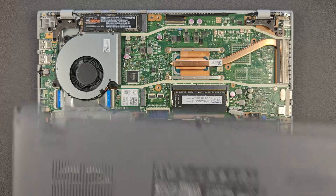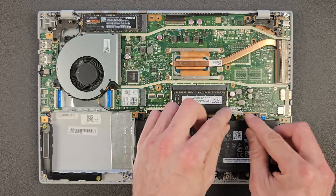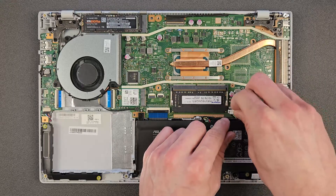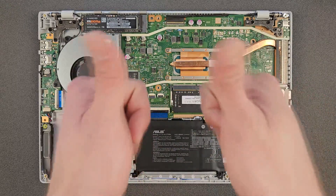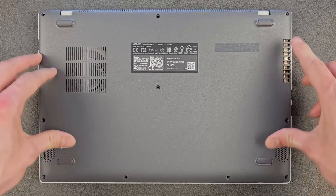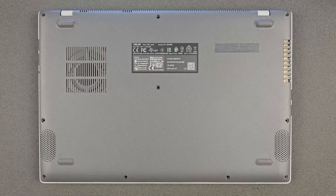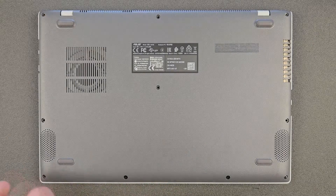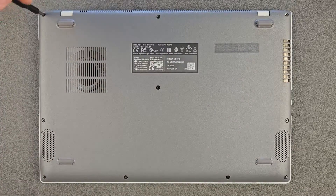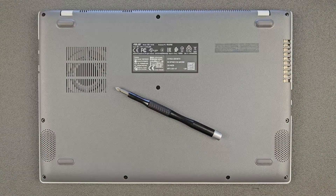You can start closing it up — oh wait, we forgot the battery connection! I've done that many times — left it disconnected, closed up, and then realized. Just push it back in there, that's it. Do not forget that. Now you can put the back panel back and screw everything in. And by the way, I installed Windows 11 on this machine afterwards. As I said, it wasn't straightforward — the drive wasn't visible during Windows installation, though you could see it in the BIOS. You'll need to do a bit of research on that.